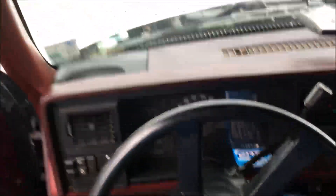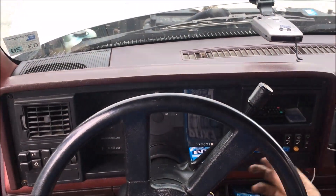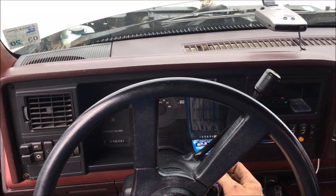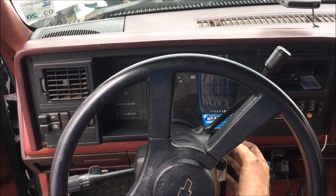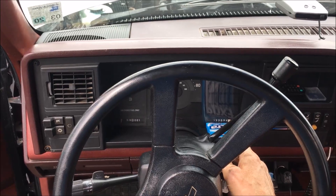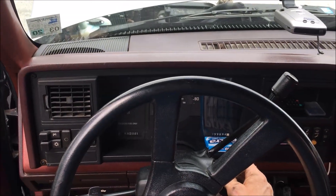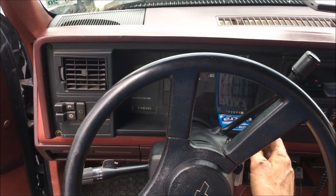Let me flip this camera around and show you what was going on. I was having trouble starting the engine after cleaning out the throttle body injector — I had flooded the engine. So I was cranking on it several seconds at a time, giving it a break, cranking some more, and all of a sudden the starter just stopped — nothing. I put a battery charger on my gel cell and it charged for a few minutes and said 100% good to go.